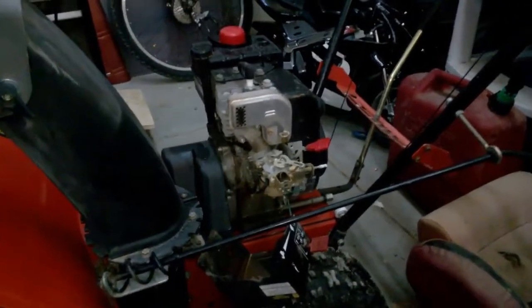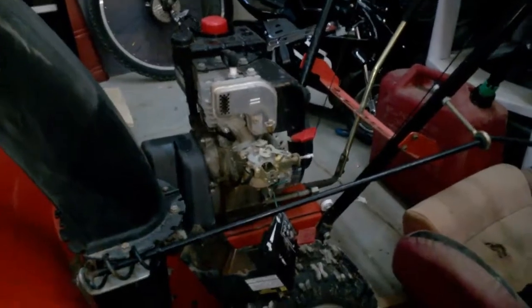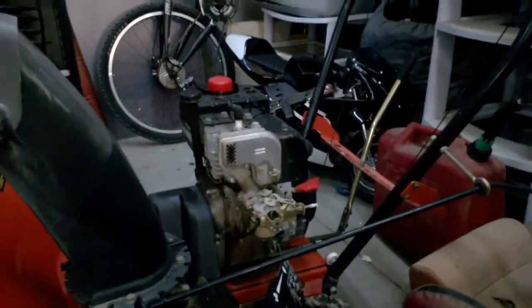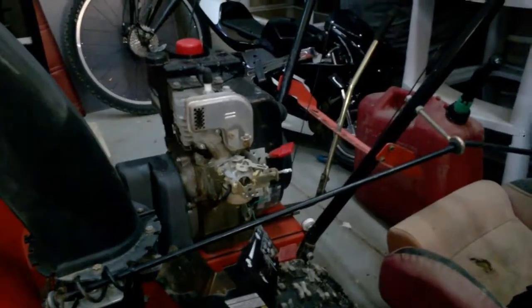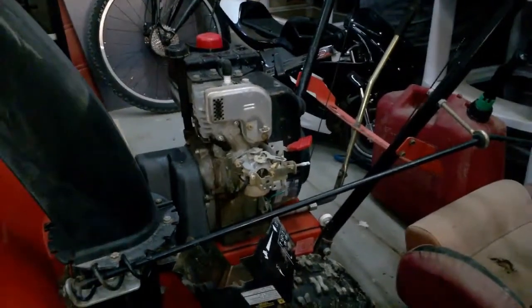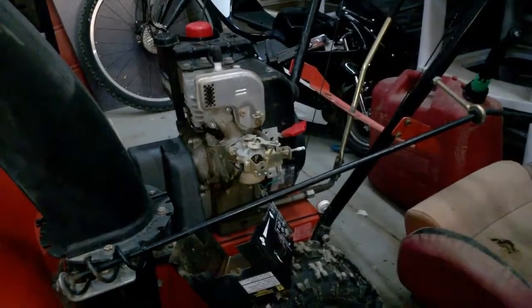So this is going to be the final video in this little project. After I got it all plugged in and fixed up, I went to start it and it'll start for a bit, but after that it shortly dies out. Which means the carburetor needs to be cleaned. I don't have time to do that all today, but I started on the soaking process — I put some carb cleaner in there, I'm going to let it soak, then come back and spray it all out. If that fixes it, it will start. If not, I'll have to pull it apart and clean it all out again.